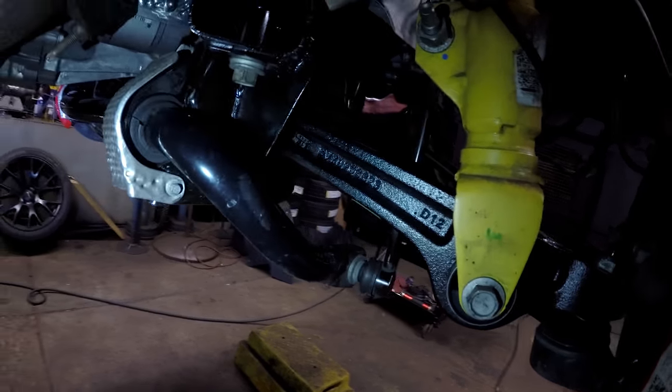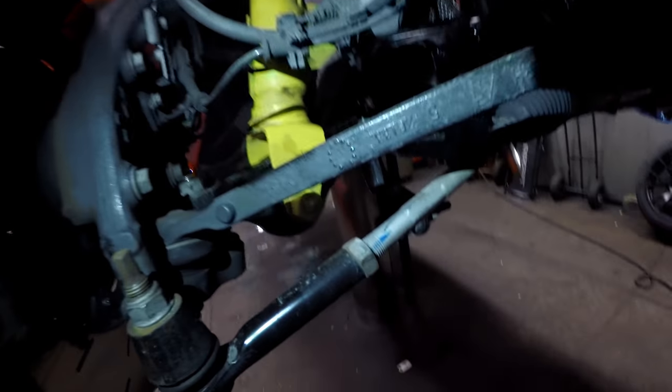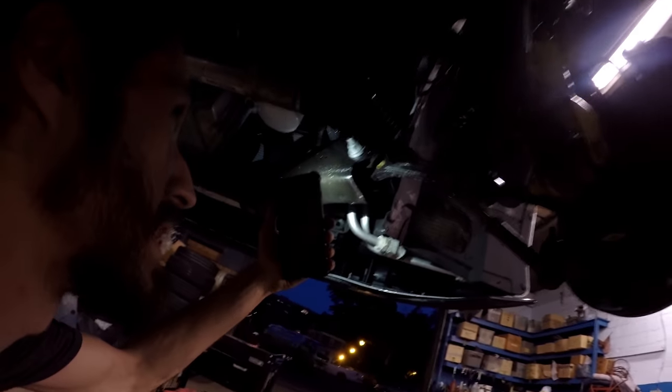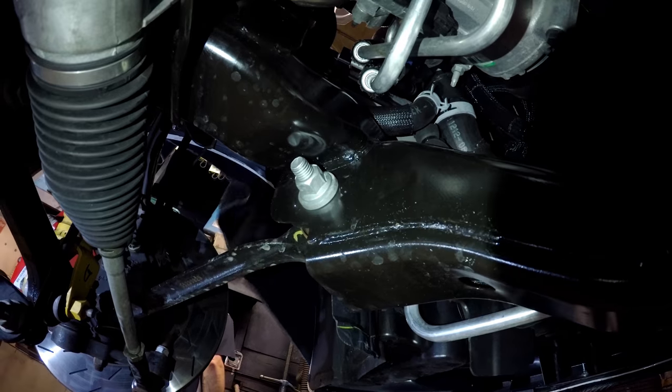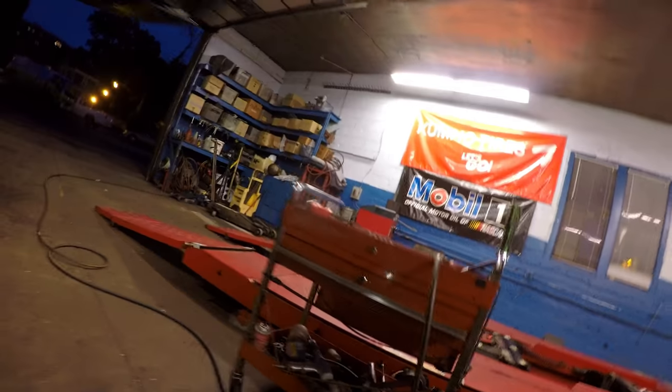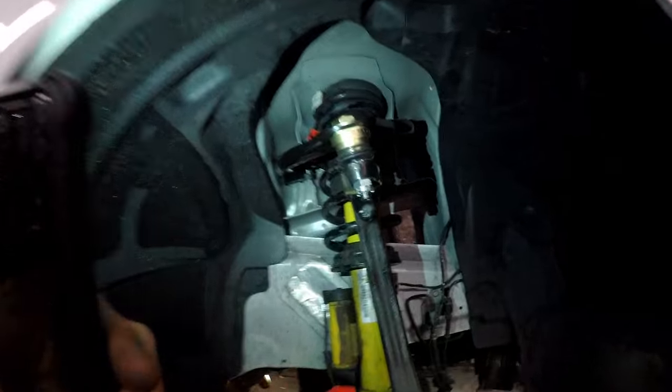You can see I got the new lower control arms in. Since Salerno Duane botched it, everything got replaced — all new bolts, all new everything on the frame. Everything looks straight, and that is what it's supposed to look like right there. That's proper — that is a proper alignment right there. There's another shot of the other side of the frame; that's how it's supposed to look: neat, organized, torqued. Using upper control arms, you don't need to be drilling the frame — I don't recommend it, I went down that path already. This is definitely the way to go.